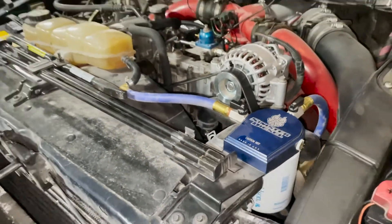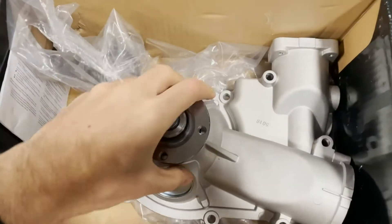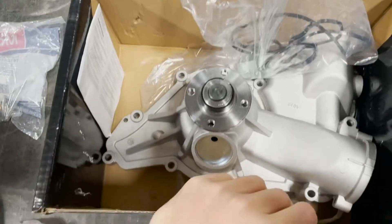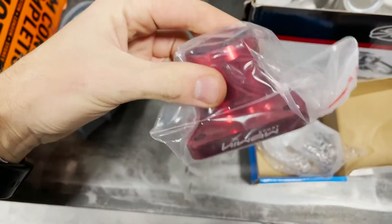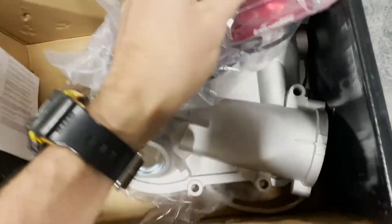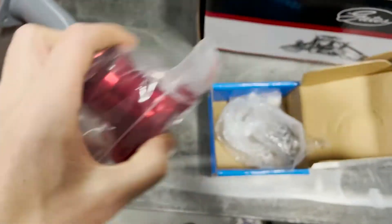To begin with, we're going to drain the coolant. Here are the new parts we're going to put in the truck: a Gates water pump with new O-rings and hardware, and this new billet water pump housing outlet. It will go right on top there — instead of the pressed metal, it has a spot for an O-ring and it will clean up real nice.